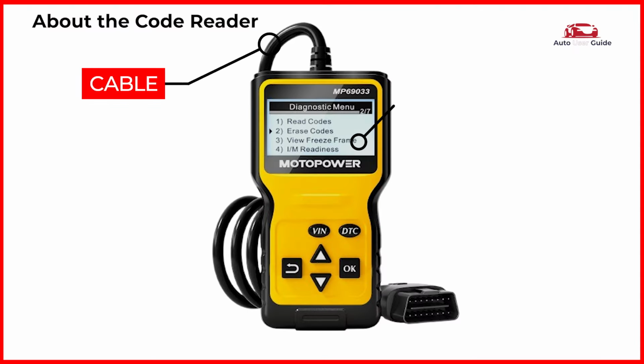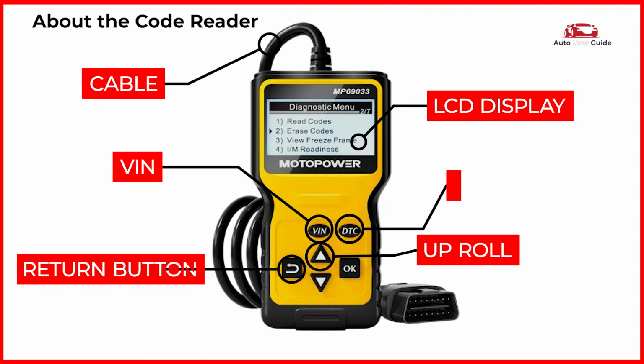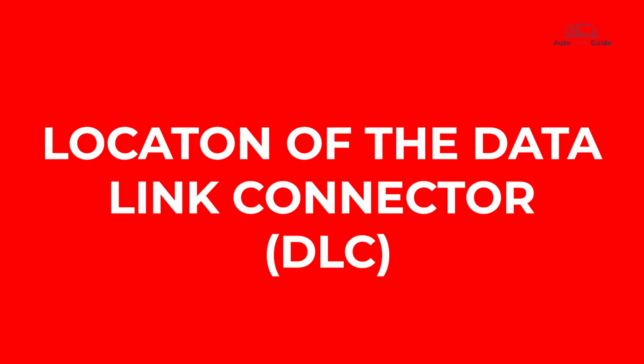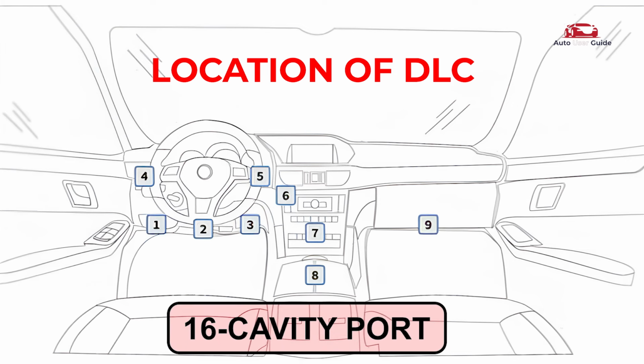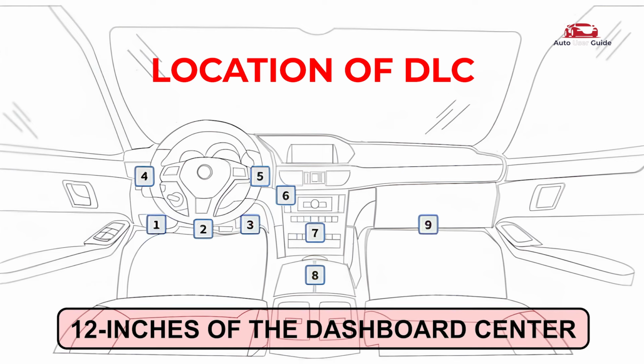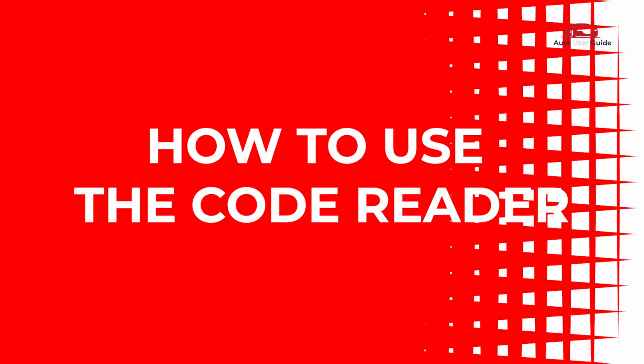Cable, LCD display, vehicle identification number, up roll, return button, one button diagnostic trouble code check, confirm, down roll. Let's see where the data link connector is located. The data link connector is a 16 cavity port for connecting diagnostic tools to the vehicle's computer. Typically found within 12 inches of the dashboard center on the driver's side, some models may have it behind the ashtray or labeled elsewhere.